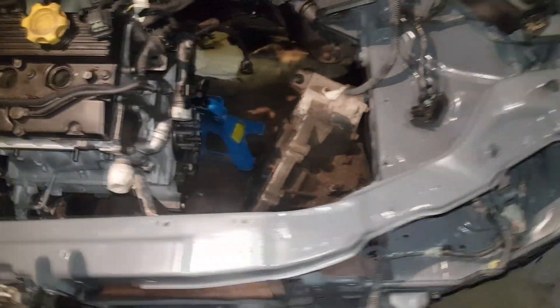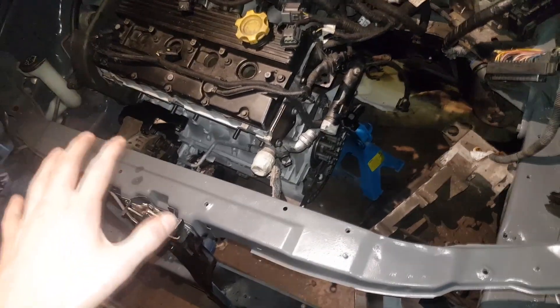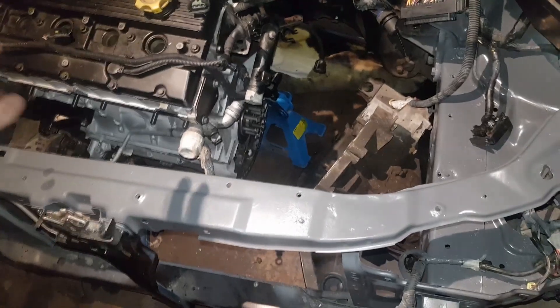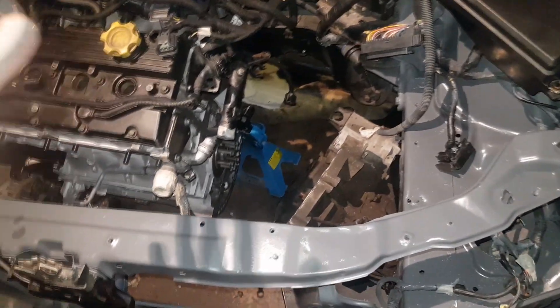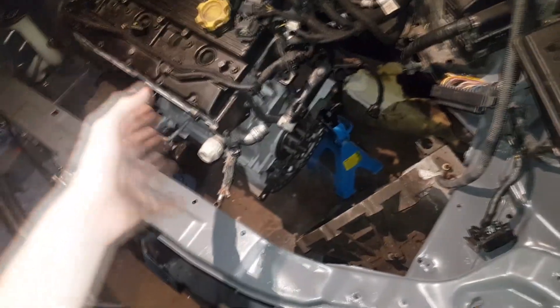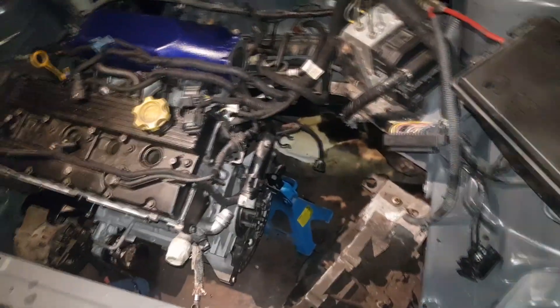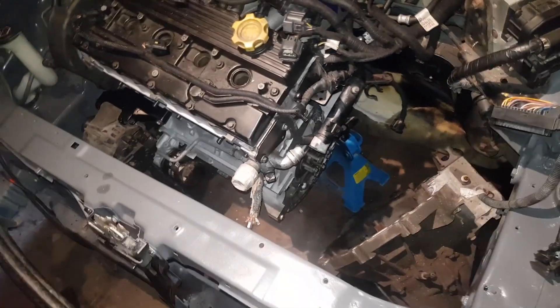The flywheel is cheap. The clutch - still not sure what clutch I'm going for yet. If you're wondering what I'm going to be doing for brakes, there's obviously around 250 horsepower with standard 14ZR brakes - not a good idea. What I'm going to be doing is a custom caliper setup. I'm going with four-pot Brembos off an R26 Megane, or I'm pretty sure it's the same as the Clio 197 cups - same calipers - and then going with some discs. I'm not quite sure what size yet. Probably j-groove them, maybe dimple them, not drilling them because no one likes cracked discs. The rears - I'll probably just do a standard 160 rear setup but with probably the same caliper, just a bigger disc and better pads.